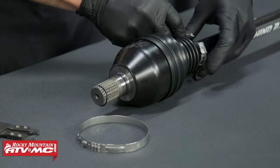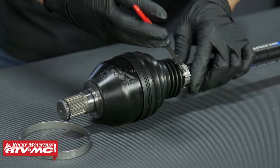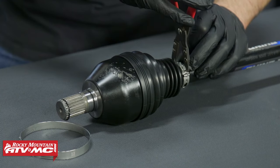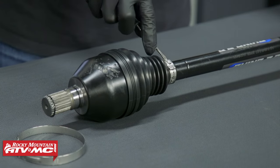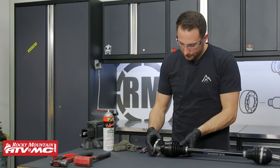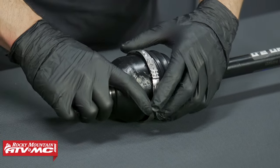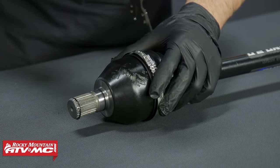Go ahead and stick the smaller clamp in place. To clamp it together, start on the front hook, go on the back one, and make the connection in the middle — squeeze that together, and push the last bit with a screwdriver until it pops into place. Now take the big clamp and do the same thing — make sure you're all the way around and clamp it down. If you have a different style of clamp, just make sure you're using the correct pliers.